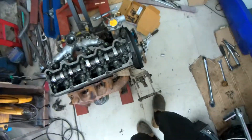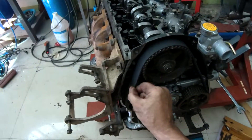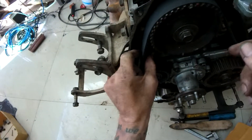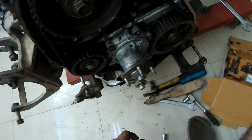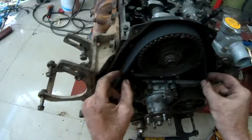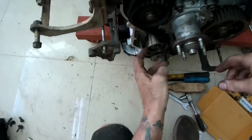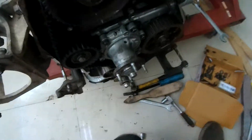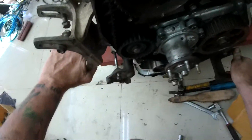One cylinder head torqued. That's amazing — it was as tight as a drum when I set that up, and it's all gone slack now where the head's squashed down. Great stuff — but we'll readjust that later on. I've got it all timed up on the pulleys.